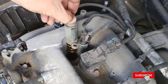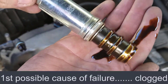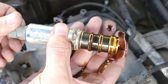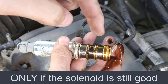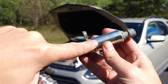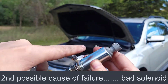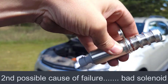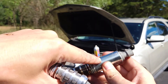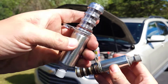It should pull straight out, and you can see all the oil dripping off it and all the gunk. You can see it's all clogged right there. You could take some WD-40, wash this off, and reuse it, but I'm just going to replace it because it's so cheap. To test if the old part is still good, you can apply 12 volts from the battery and you should hear the solenoid clicking. Just shaking it, the old one sounds a lot looser than the new one — something seems much more loose inside. The new one feels solid, so the old one might still be intermittently working, but I'm going to replace it.